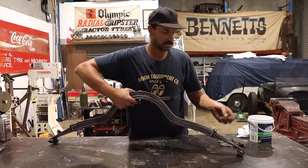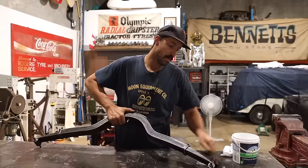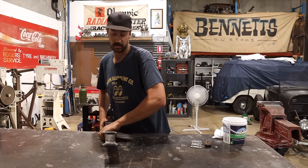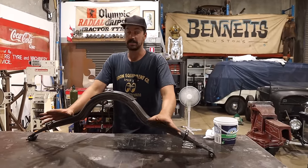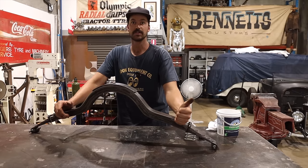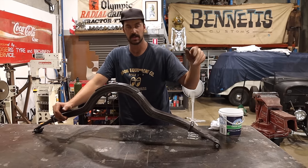So these are the shackles we'll end up using — shaft there, and then you'd have a nut that would go on like so. We'll have the same stud pattern set up on the rear '36 radius rods and basically job done. When running these inside, the width is obviously going to be a little bit different — so making up that difference from two inch to two and a quarter inch makes an easy job of it. This might not be the exact amount of leafs we're going to run — we may have to add one. That's going to be the trial and error part, especially when setting up the final ride height. Speaking with Brad, he makes a very good point — it happened with my green roadster as well. Once you've got a full tank and you're riding around, those springs settle out. It takes four, five, six months and your ride height is a lot different, so it'll take a little bit to find the final adjustment.